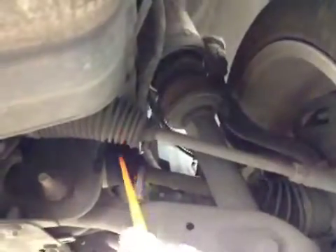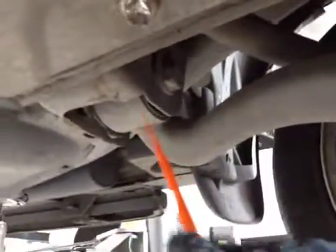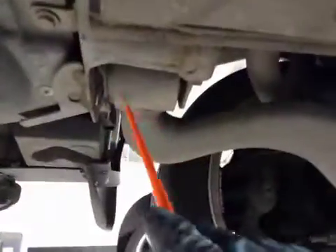Your passenger side front suspension and steering rack gators, driveshaft gators — the suspension components are all ok except for your rear wishbone bushes. They're knocking, they've got excessive movement, and there's a foul on the MOT on these bushes here.